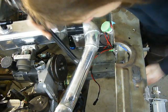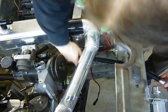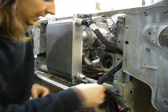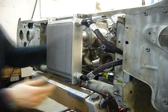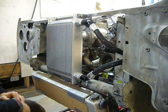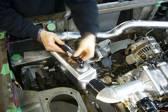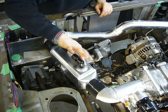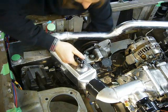So that's the first line made. I just have to do two more and the plumbing will be complete. The lower hose was assembled in exactly the same way as the upper hose. This is the water outlet of the intercooler, which is being plumbed to the bottom of the heat exchanger — so hopefully any air bubbles that become trapped will exit the top of the heat exchanger and end up back in the tank. The system should be self-degassing.